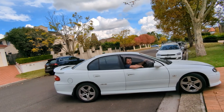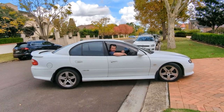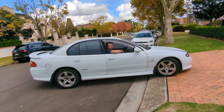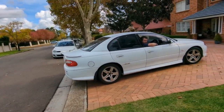Taking off in drive there's nothing, but you put it back into first and it takes off fine. Once you get up to speed and it's in drive, it drives perfectly and kicks down and drives fine — it's just when it's taking off. It is shifting though, so that's progress. You put it in first, take off fine, get up to normal speed, put it into drive and it drives fine, and then it kicks down.